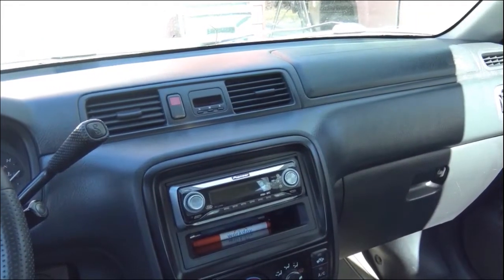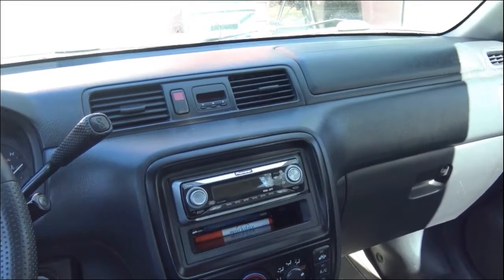So if you find yourself with a Honda CR-V 2000 — the 98s are the same, maybe 2001 as well — just try pulling the fuse out. You don't have to replace the fuse because the fuse doesn't blow, just pull it out so the door locks won't work automatically. I can manually lock them with no problem and no resistance, and for the last door out I just use the key. The fob stopped working years ago anyway. I hope this helps.